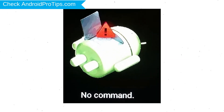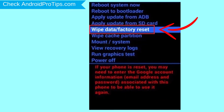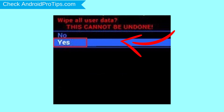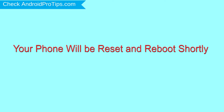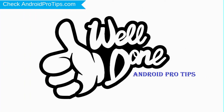Afterward, you will see Android! Then while holding down the power button, press and release the volume up button. Choose the option to wipe data and factory reset with volume buttons to select and power button to accept. Next, select yes option. Finally, select reboot system now option. Your phone will be reset and reboot shortly. Well done, you have successfully reset your mobile.